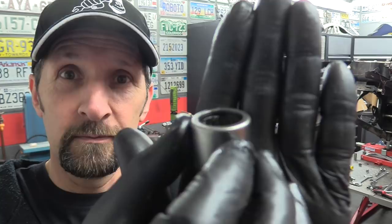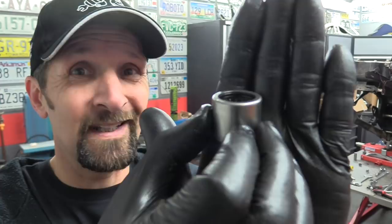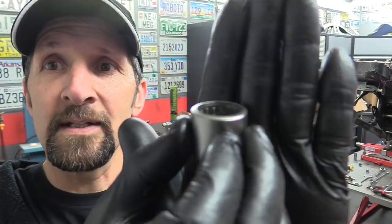And then you see the rollers start. So the gap between the rollers and the outer edge of the seal casing is about 5 mil on this particular bearing. If I spin it over, the rollers are right near the top and there's no seal. Now, naturally, the seal will always go to the outside to keep the weather out. So therefore, it's the side with the seal and the flat face that's outermost. If you're in any doubt, take photos of the bearings before you take them out, and there you know which way they go in, simple as that.